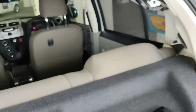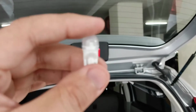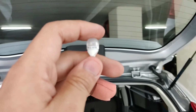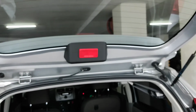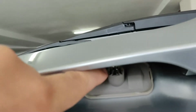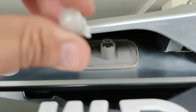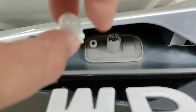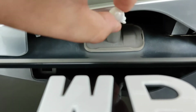and replace it. I'm going to use this kind, the Osram W5W for this case. So what you can do now is look for the slot in here. The slot in here says that the bulb has to go in vertically in this direction. That means this clip must go in vertically. So align the hole and the bulb itself.